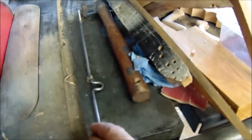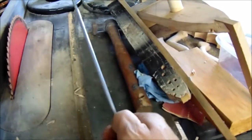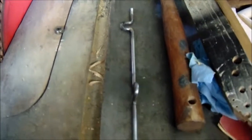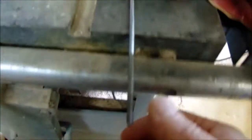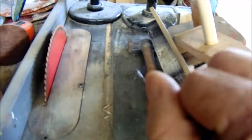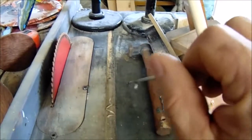With the crank, you need to make sure it's flat on all planes — that's really important. Check that it's straight this way, make sure it's perfectly straight this way. I even like to look down the end of it and turn it to make sure it looks straight.